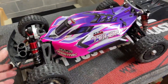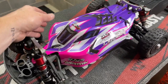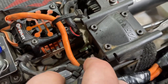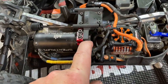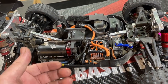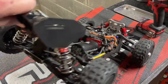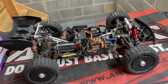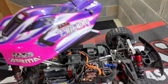I hope you enjoyed the video today on differential maintenance, the things to look out for, and where to go when you start encountering noises. Keep an eye on all the drive cups — not just on your diff but on your center too. Keep a very close eye on your motor mesh and pinion as well, making sure none of that is loosening up, because as soon as that starts to loosen you'll destroy your pinion and spur gear and that'll end your bash for the day. If you have any questions, feel free to drop them in the comments — I always answer everybody back. Until next time, be safe, be careful. Peace out everybody.